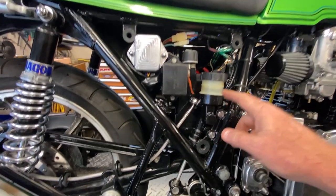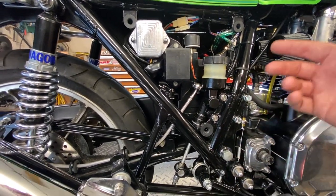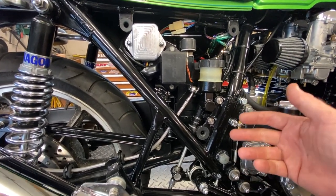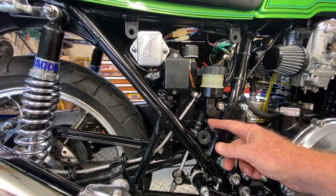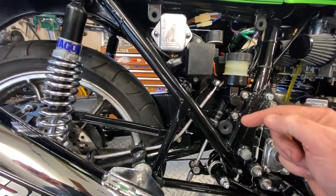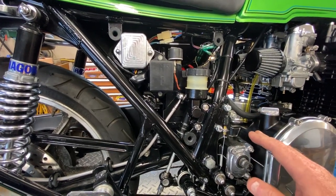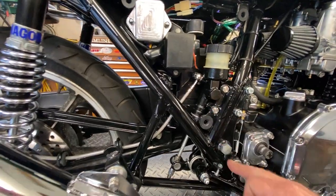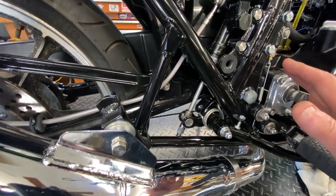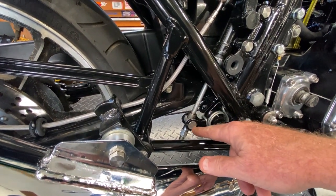This time it's leaking from the central bore where the piston is. I replaced that seal with a rubber part that was exactly the same — a Honda one that fit a 5/8 bore — and it worked perfectly. I did have trouble getting this bled up, and the reason it's leaking now is because the inside of this bore is all corroded. I did the best I could to hone it out — it worked, but it's leaking right down the rod here. It's dripping out the shaft.